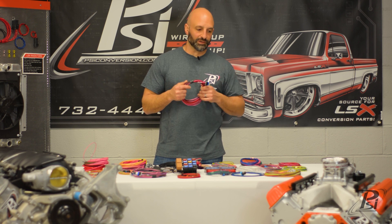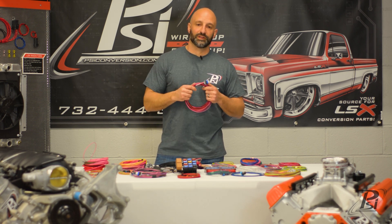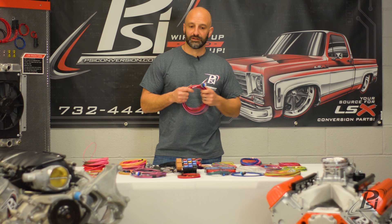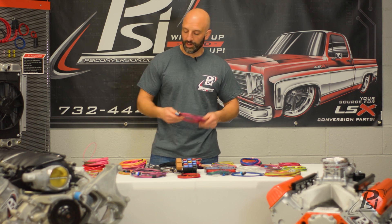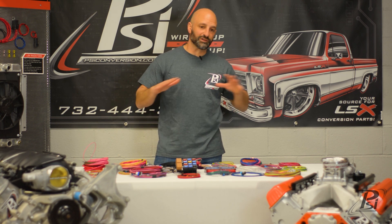When you start out, you're going to start at the engine side and route everything up, let's say, under the dash. With 15 feet, it'll reach all the way into the trunk, or you could put it under the seat or behind the firewall — wherever you determine you're going to terminate it. You go piece by piece: you'd connect each coil, each injector, the map sensor, cam sensor, every single thing, including the transmission.